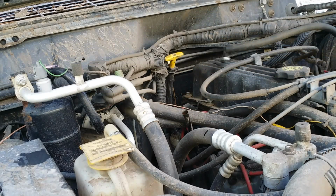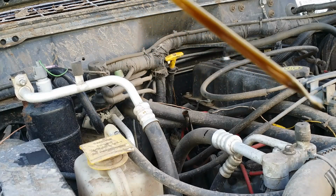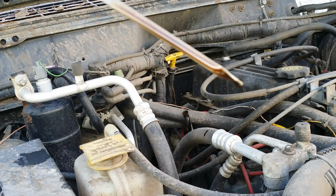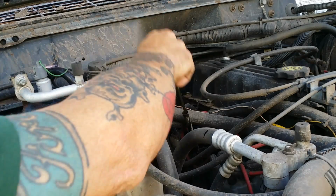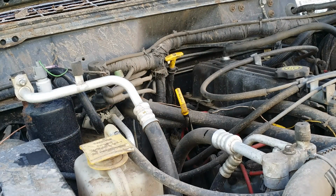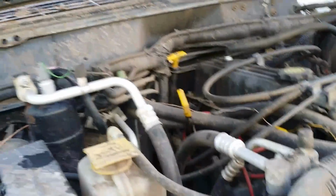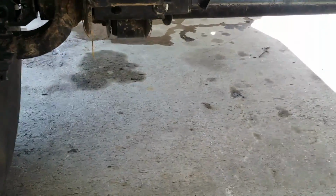Engine oil's clean. No water in it. I checked the rear diff already. I did that first thing when I got home last night because it was underwater for 15 minutes. It's good. I haven't checked the front end yet. And that was the other reason I got them end seals there, the seals that go on inside the axle on this end, that way it's double sealed.